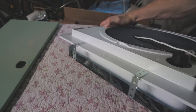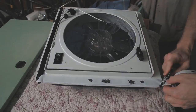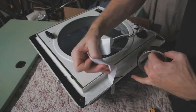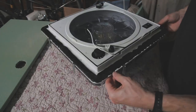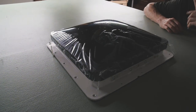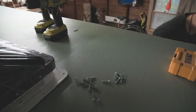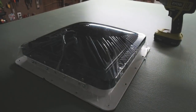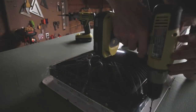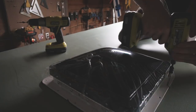Before attaching the fan to the roof, I added some small metal brackets, which I'll explain in a minute. For the roof vent, I also used butyl tape to seal it up — I bought a 30-foot roll and the five windows plus fan took all of it. I pre-drilled holes in the roof for the screws because the ones I used were not self-drilling. The butyl tape stuck all over the drill bit, so I considered skipping pre-drilling, but I was too nervous about cracking the wood so I pre-drilled the rest. Be careful not to put these screws in too tight or you can crack the plastic — I learned that one the hard way.